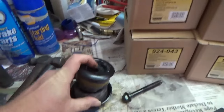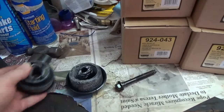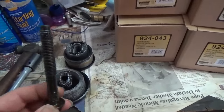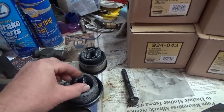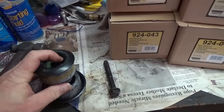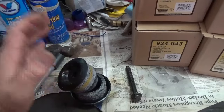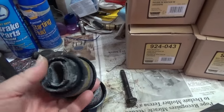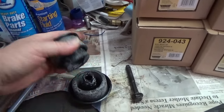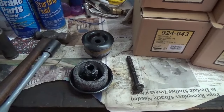Here is the full assembly to go back in, and here are your pieces. That is oval shaped, so of course you're going to have to have your oval lined up when you put that on. One of the problems is this bolt isn't long enough for you to get up through and into that nut to be able to squeeze this all together. So my next thing is I'm going to try and find a longer bolt or see if I have something that I can squeeze each one of these together as they go in there. They tell you you shouldn't really use any lubes that aren't called for, so we'll probably just go with this and try and get a longer bolt.